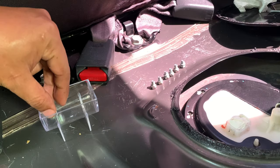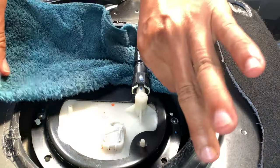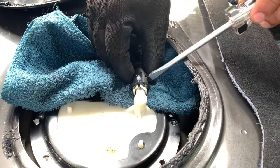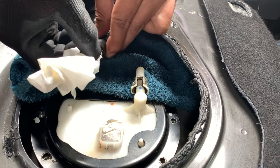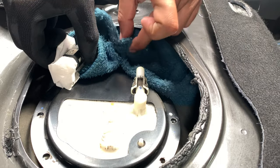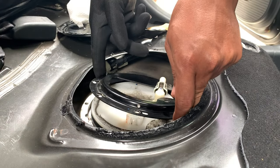Let's keep these things in a safe place. Place a rag under the fuel suction tube in case some fuel would leak out. Use a flat head screwdriver to remove this hose. Place a paper towel into the fuel tube to protect it from dirt. Remove the rag and get the tube out of the way. Take out the fuel pump bracket like so.